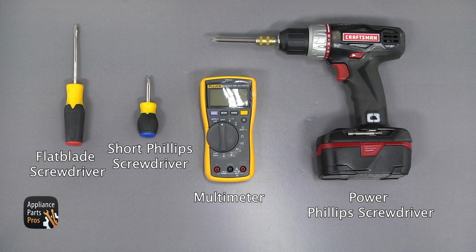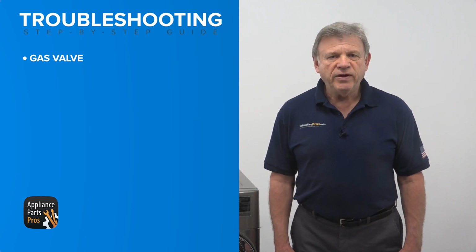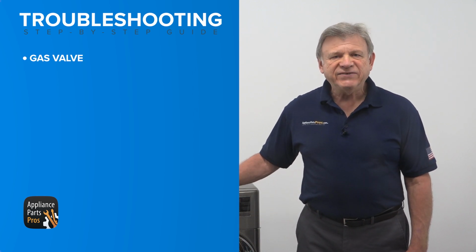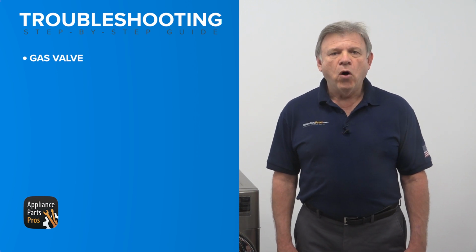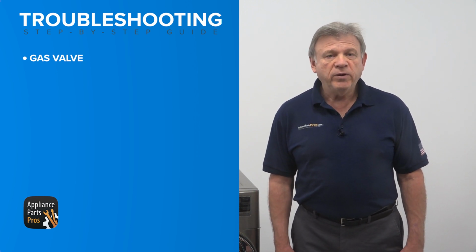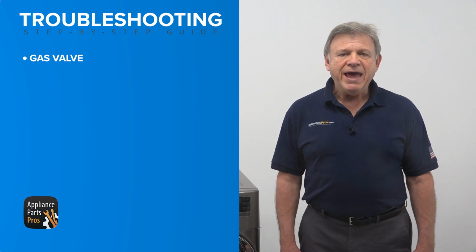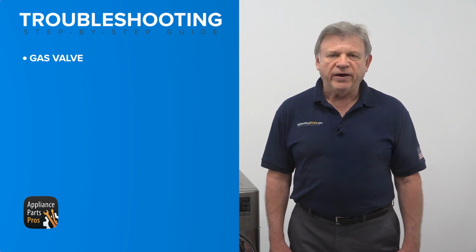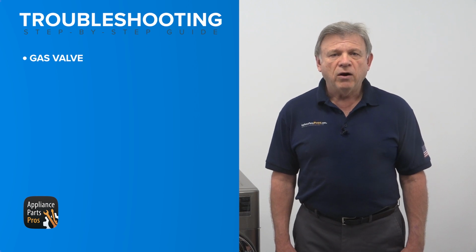For this job, we're going to need a flatblade screwdriver, a short Phillips screwdriver, a multimeter, a power Phillips screwdriver, and the vacuum cleaner. The burning gas is a source of heat in our dryer, and the gas valve controls the flow of gas, opening and closing it on demand. The gas valve is operated by 2 electromagnetic coils and 2 internal membranes and controlled by a number of safety devices. The valve is located near the bottom of the dryer on the right.